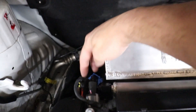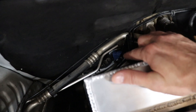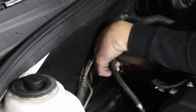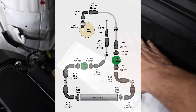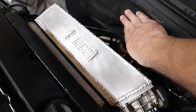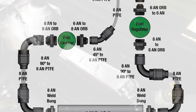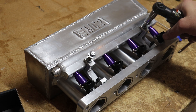Some of the other things I still have to take care of is obviously the fuel. I've got a 90-degree fitting hooked up for now, capped off. The idea is I cut the fuel line over here and we're going to tap into the hard line down there. We've got some PTFE line that's going to run up to our damper and then come to the fuel rail. I was hoping to mount my fuel pressure regulator right here, but there's not enough space, so we'll mount it somewhere on the firewall and run a line all the way back to the fuel tank to return unused fuel. We've got our new injectors seated in there, which I'll cover in an upcoming video.